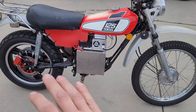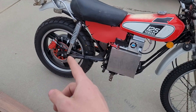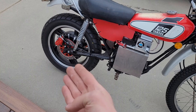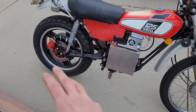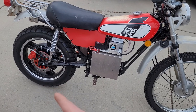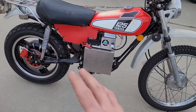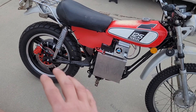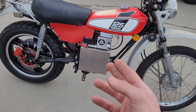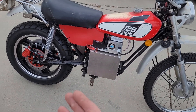Overall, this bike will go 55 miles an hour. You can pick all sorts of different speeds based on your hub — all hubs will have the same power, but the kV ratio changes that. If I want to go faster, I end up having less torque overall. If I want crazy amounts of torque, I don't have as much top speed. So 55 I thought was a pretty good balance. This thing isn't crazy torquey — it's probably similar to what the stock gas bike was — but you could change that.